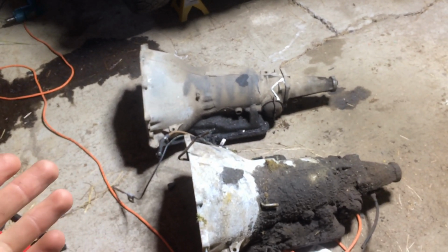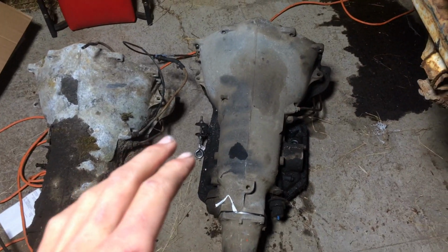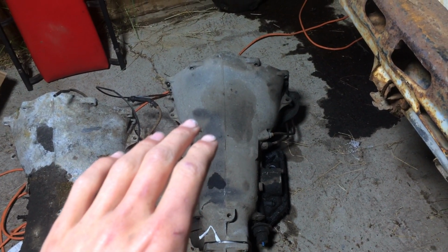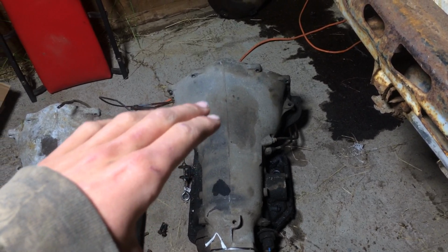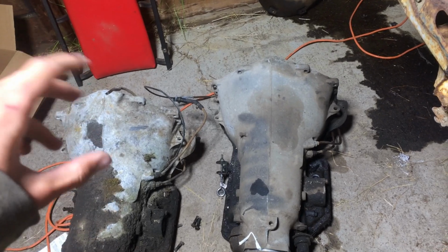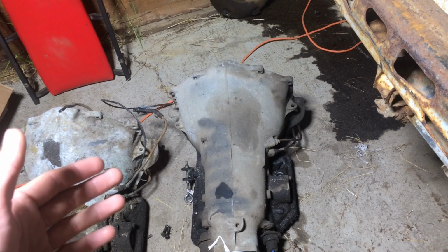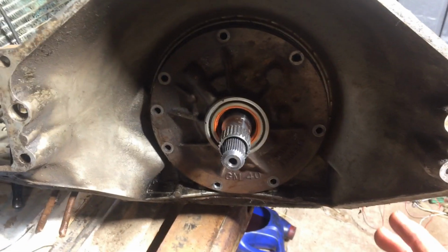Well, what's left is the transmission. That's the tough part. It's not really that tough. I need a transmission. It bolts right in now. Everything's fabricated. And since I don't have forwards, I only have reverse. I have no forwards gears on this transmission. It's got to be my forwards clutch pack, which is right behind the oil pump. So I'm hoping to pull the oil pump out, grab these clutches out, have a look at this one, change some clutches back and forth, maybe make something that's better, or make something work, and throw it back together, and hopefully it'll work.